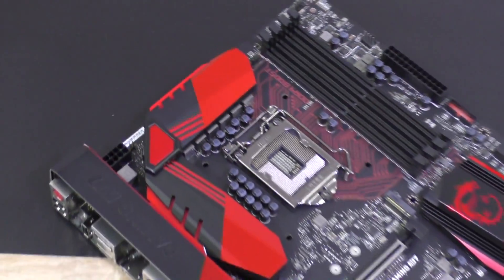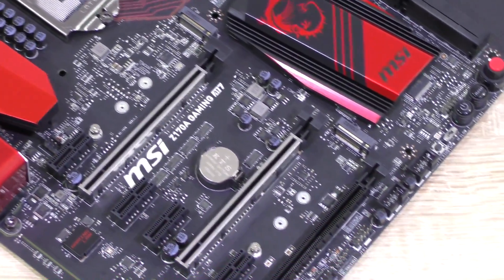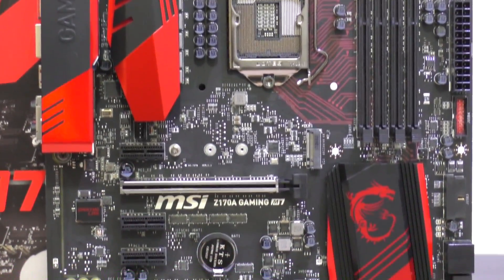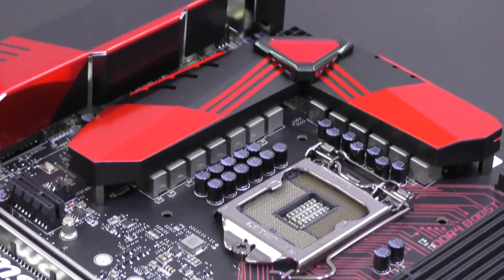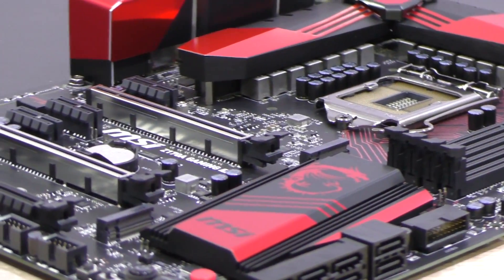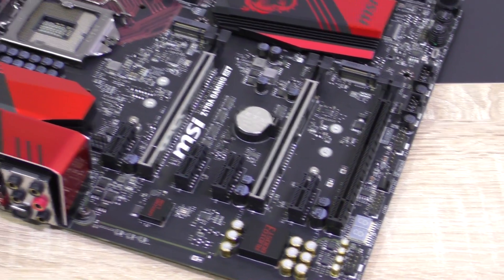The reason for that was Enhanced Turbo was enabled in the BIOS, which makes all CPU cores run at the turbo boost clock speed. I had disabled that feature, but at the time I tested the M7 the BIOS hadn't matured yet, as with all BIOSes on motherboards. So that feature was buggy on my board, but after fiddling around a bit I managed to actually disable that feature to run my CPU at the actual stock speeds. The next BIOS update fixed the bug anyways, but I don't just want to blame it all on the BIOS. It was my fault too, and I admit it. I was tired and simply did not pay enough attention — I should have known.